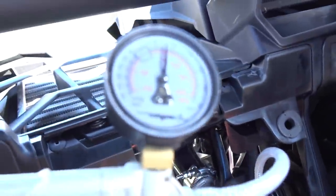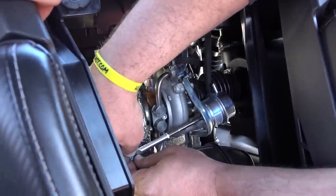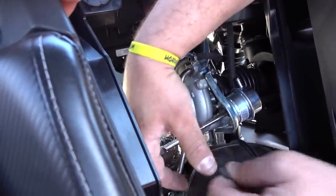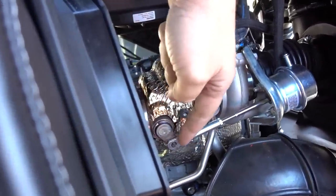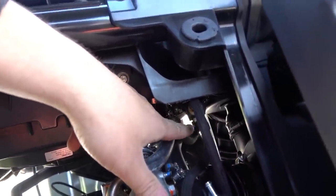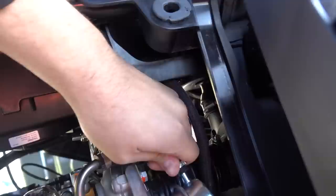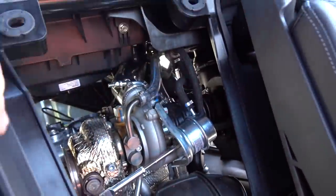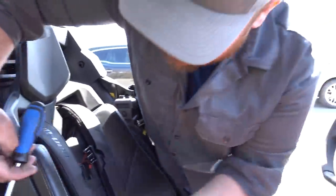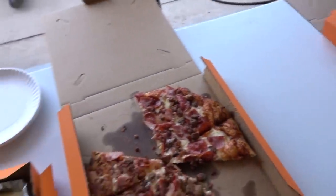If you make this adjustment incorrectly you'll be running too much boost — you don't want that, could hurt your motor. Mighty Vac life — dropping it into the oblivion. Sounds like Jason just got tuned because the fuel pump kicked on. Hook the clip back onto this and the boost line from the boost pressure solenoid slides back on here. You can put the Oetiker clamp on if you need to but these hold pretty well if you just get it to slide onto the new wastegate. Other than that, just down to the cat bypass pipe — that's it!